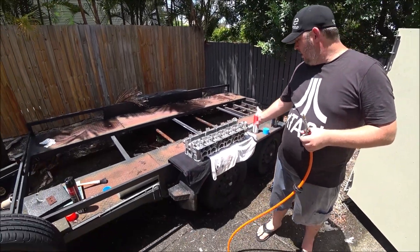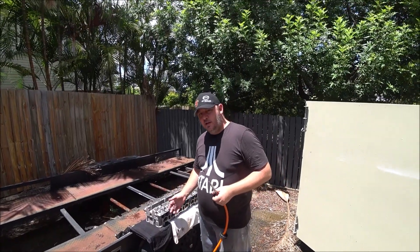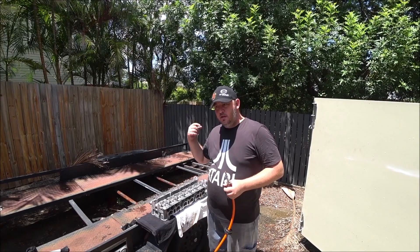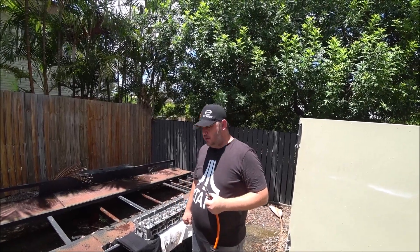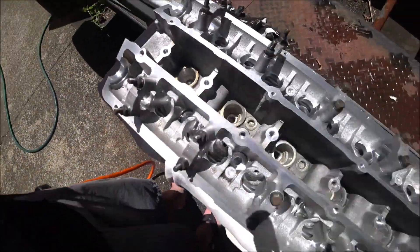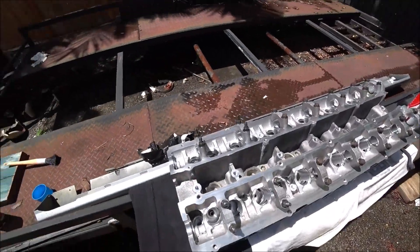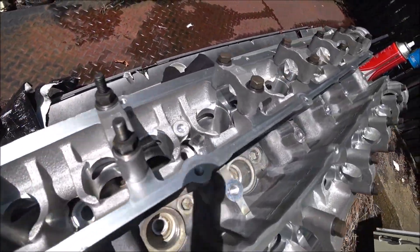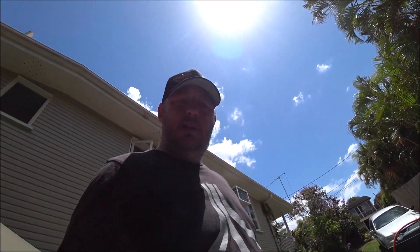As you can see, the head is done and cleaned. I took the tape off because it was dissolving the adhesive anyway - I didn't have anything really to worry about because there was no swarf stuck to the underside of that tape. I did want to make sure I wasn't going to leave something in there that could damage the already-surfaced face. It's now ready to be assembled - you can see down there where the valve stem seals go. It is not pristine, it is not perfect, but it's pretty bloody clean. I also made sure to get in all these galleries and flood out anything untoward like degreaser or brake cleaner to make sure everything is fully flushed out. That head, after it dries in the sun for a bit, will be ready to go in the car, which I'm very happy about.